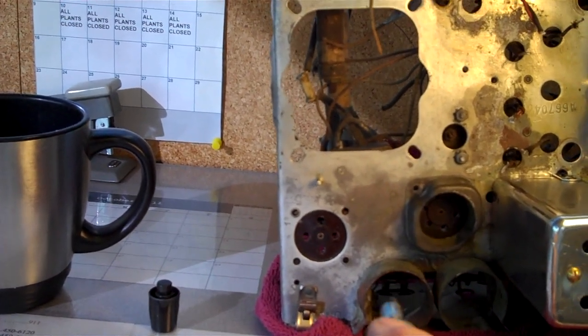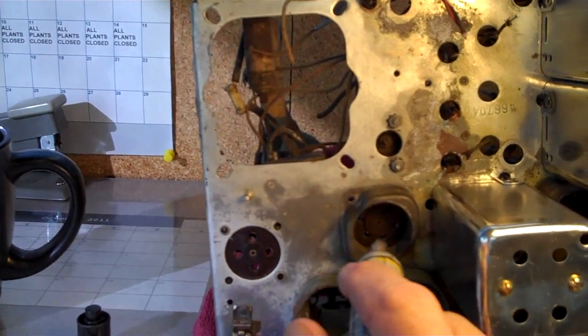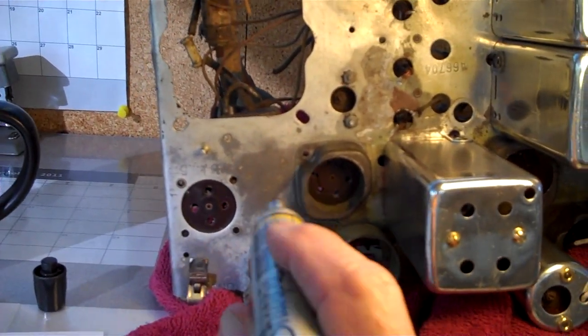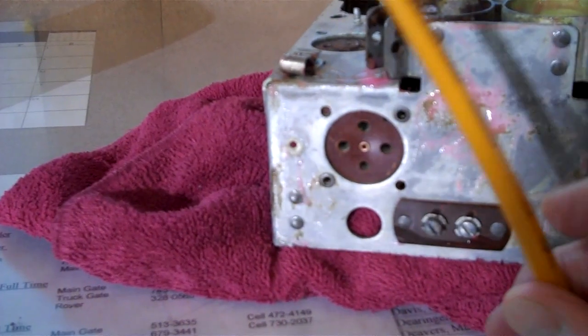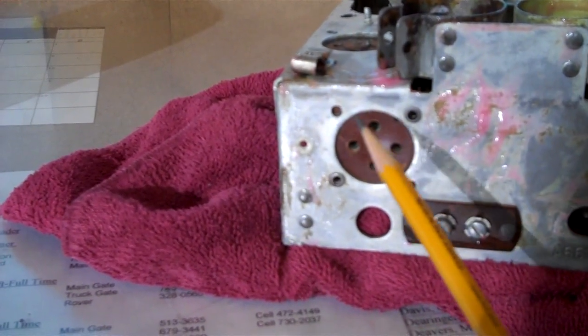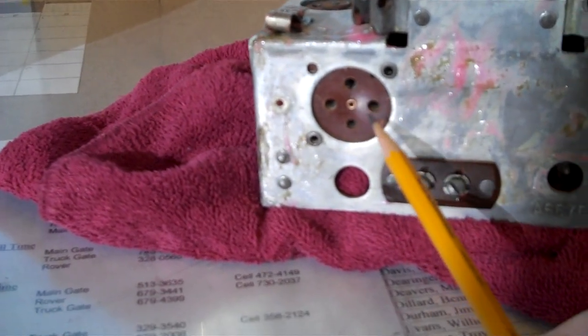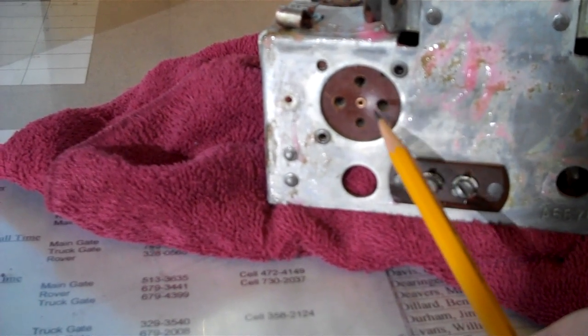You can fuse them. You can put all kinds of new wires in them, new modern tubes, but it all boils down to the old tube socket where the high voltages are and the tubes. So be careful. By the way, what I just told you also applies to speaker plug sockets. Lots of high voltage there, lots of sparks.